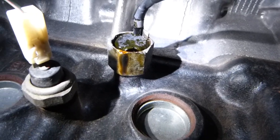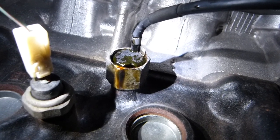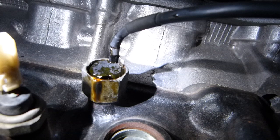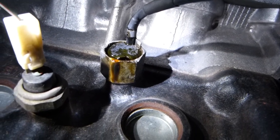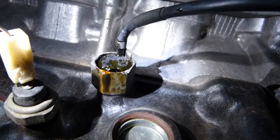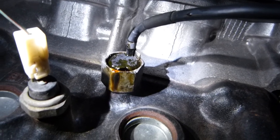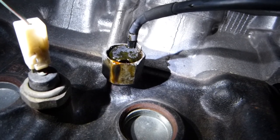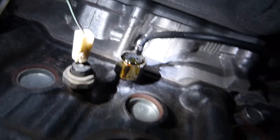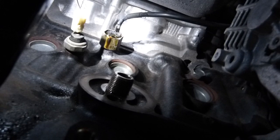So these sensors are miserable to access. That brown discoloration on the knock sensor is some kind of resin that this microphone is coated with. That's how it comes from the factory, that's how this particular sensor was assembled. The overflow of the resin and dripping down — that's not normal, but that's how this was done.